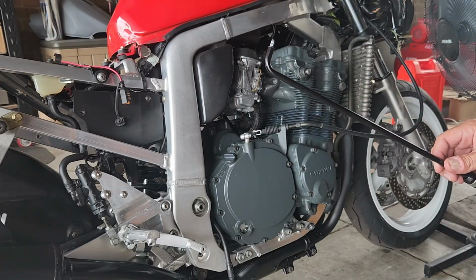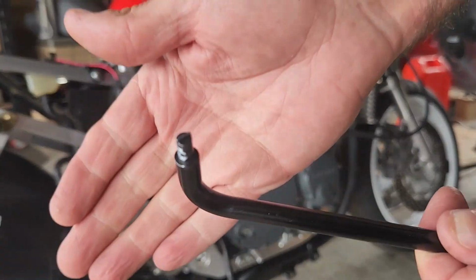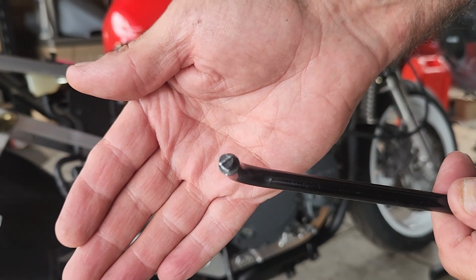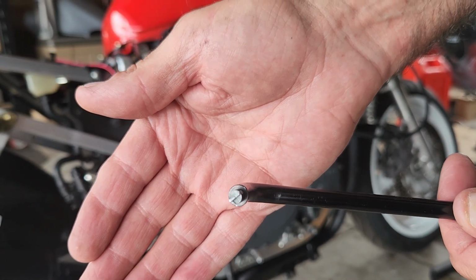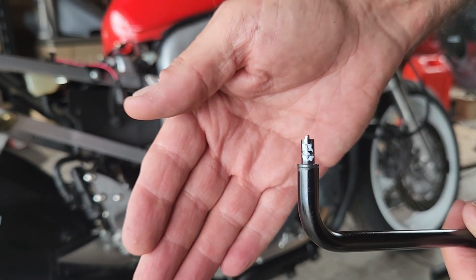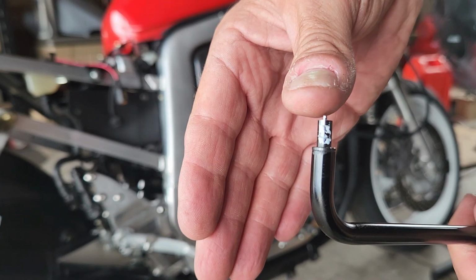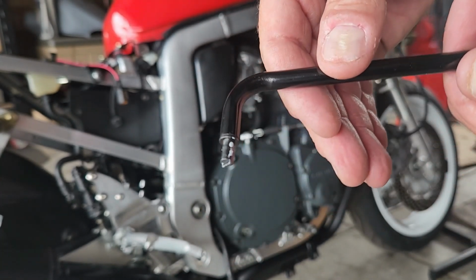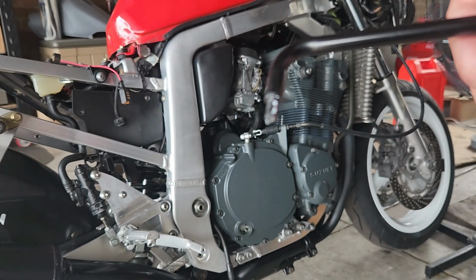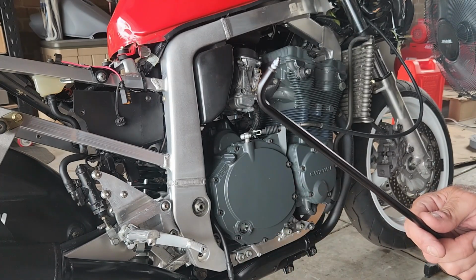Very nice tool. Corner screwdriver. The tip is a flat screwdriver. It fits exactly for pilot screws. Now, a small mod that I did in order to count the turns is I colored it white here, and I put a black line in the middle and just a white line on the other side, so I know where I have half a turn twist each time.